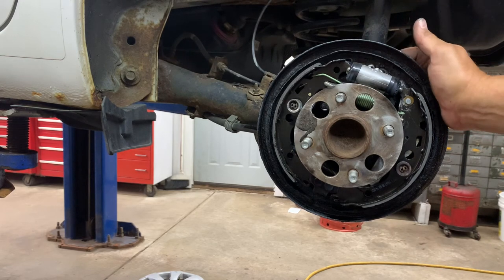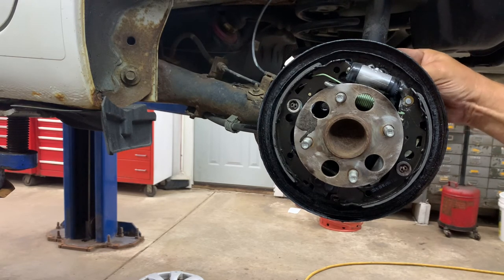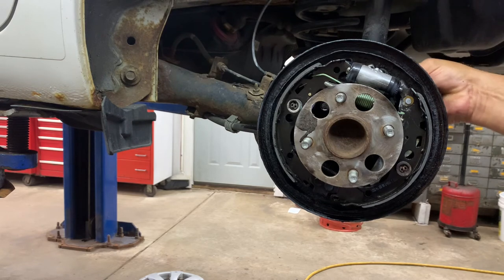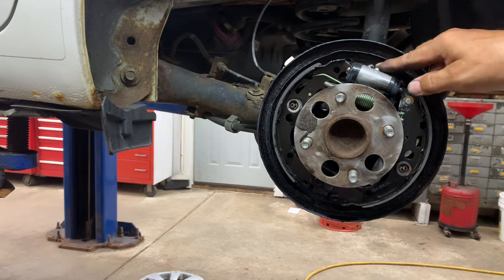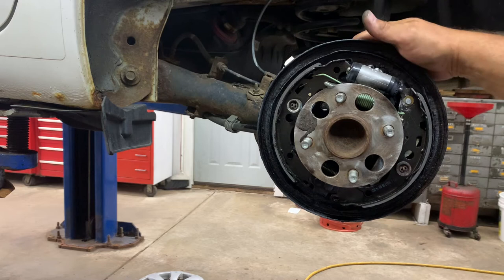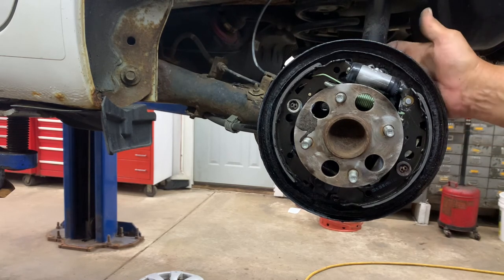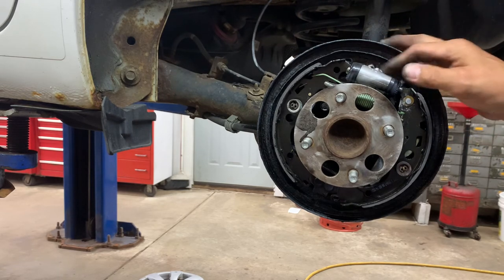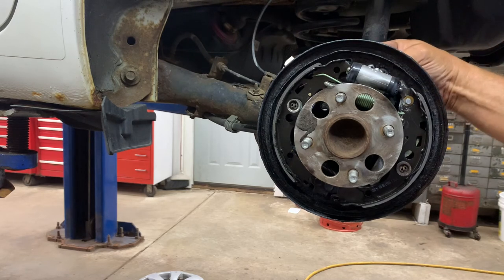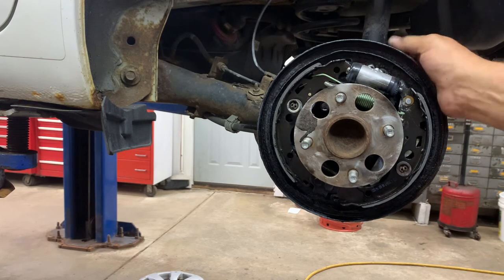And then once you get the line undone, then you can take off the bleeder, break the bleeder off or take it off, and then you can go in there and get your 10 millimeter and take out the fastener that holds the wheel cylinder on. This has got one nut, one bolt on the back side. And then take the bolt out, take your wheel cylinder out, clean up around it, put your new one in, put some anti-seize on your bolt that holds the wheel cylinder on, put that in there, remove your bleeder screw,